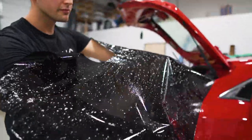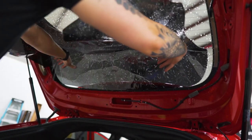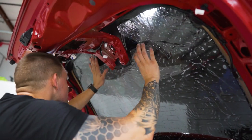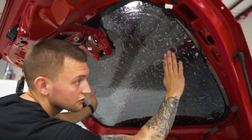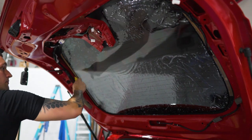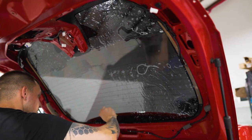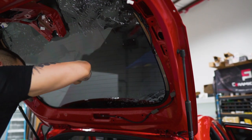Grab the film off the door, make sure the edges aren't folded. Get that top on first. Once the top is lined up, roll it right into place, adjusting as you go. Once that's in place, double and triple check all the edges for any light gaps. Start squeegeeing with the H pattern, then go down the center, then to the sides. Make sure the film is completely spread out onto the glass with no pressure fingers popping up. Overlap every stroke.